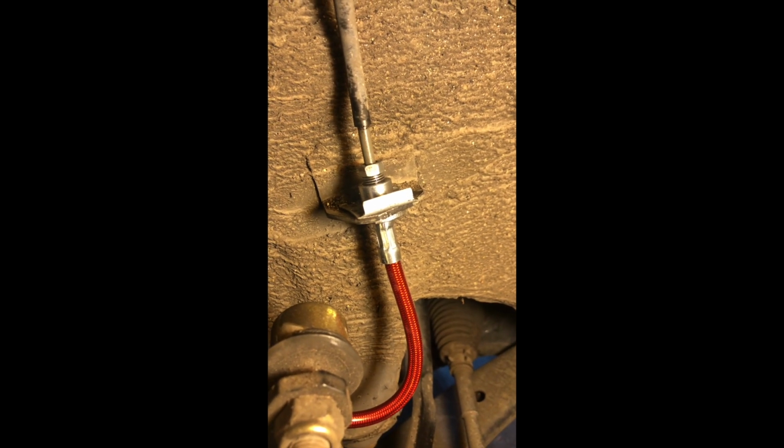All right. So the brake hose is connected there. Clip this back on. It runs down and around. The new brake lines came with a new little clip, already around the brake hose, so you can see the bolt there that goes into there. It also goes through a little hole for the speed sensor wire there.